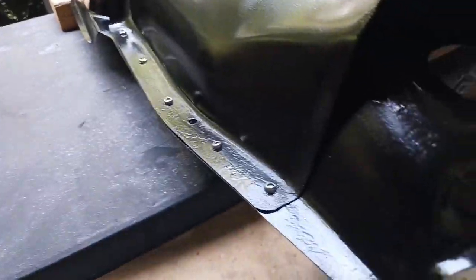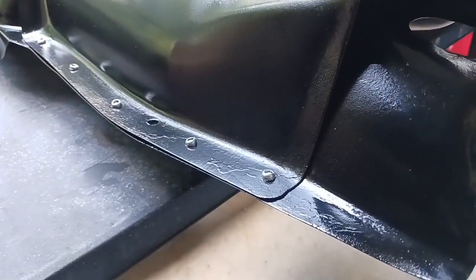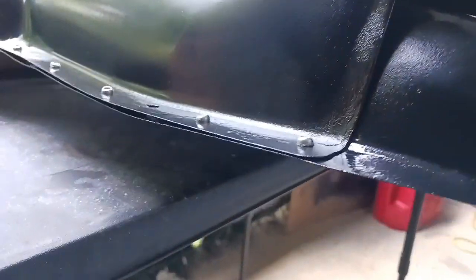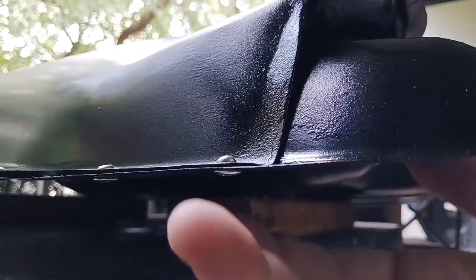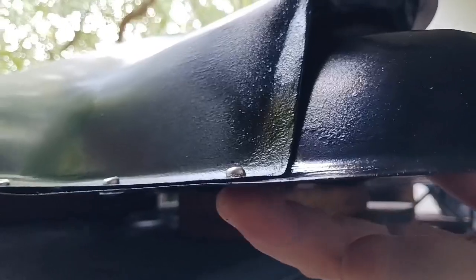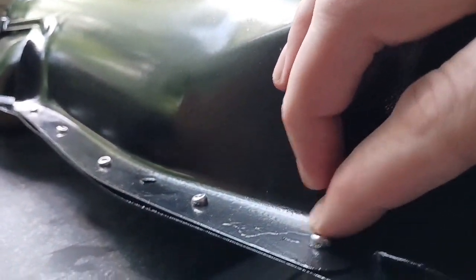I was playing with my new pop rivet gun, and I learned a couple of things. A $20 pop rivet gun is kind of funky to work with. I had to fight with it a little bit. And another thing is, I was practicing with it, fixing this side, and I had this thing flipped over. I applied the rivets from this side, and I realized the smooth side is the one you apply it from, and the other side mushrooms out and sticks up like this.